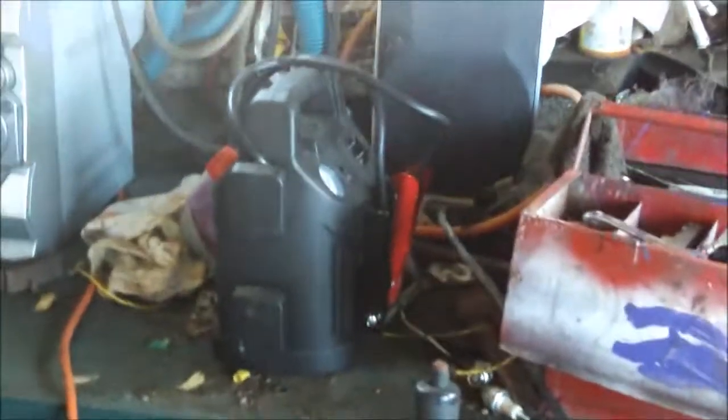It's so cramped in here — I could only get to one spot to adjust it. I gotta get some of this stuff out of here. The green thing's going, the 525, and the Simplicity over there. It's a mess but it's an organized mess. While I listen to Katy Perry, I'm going to adjust this screw right below the float bowl — which you can't really see — or the fuel pump. I'm gonna see if I can start it with the choke.